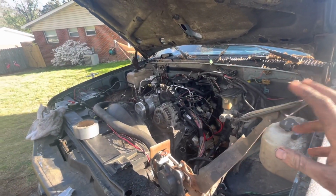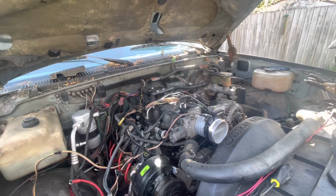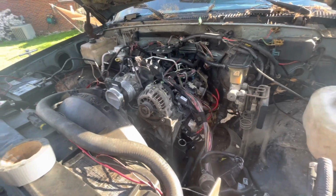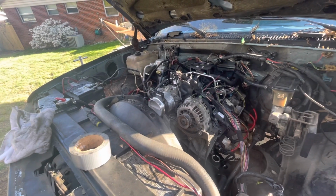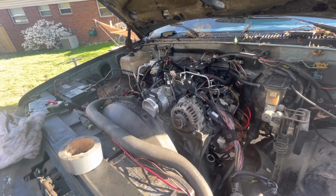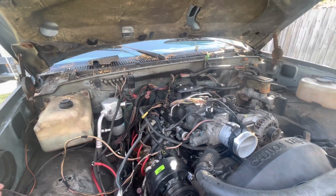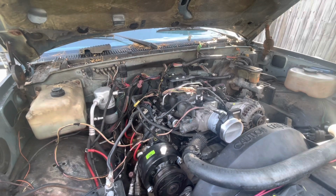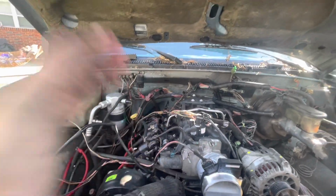Throttle. It's weird. I guess I gotta figure that one out. May not be hitting on all cylinders either. It's not getting proper fuel pressure, one of the two. Also, I ain't got any of the vacuum lines hooked up except for that one. So, fuel pressure regulator, and then wherever this thing goes, I gotta figure that out. She's a runner!